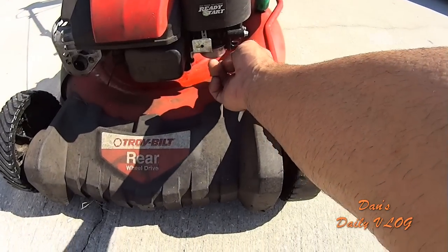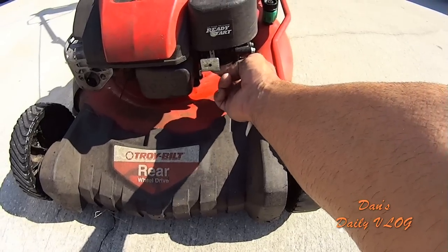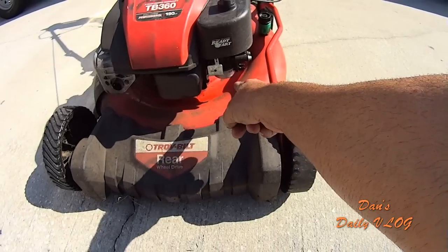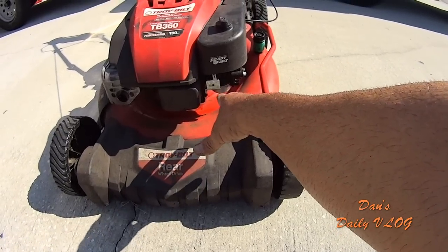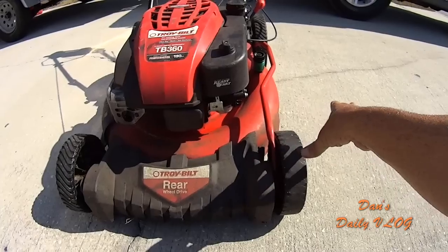The bowl is right here. You can pull this bowl super fast with, I believe, a 10 millimeter or 12 millimeter socket. You could drop this bowl. You got your needle and float right there. You can do your quick cleaning. No problems, no issues. Get it back together. You don't have to take a whole bunch of crap off.